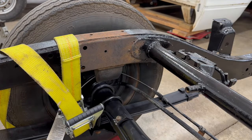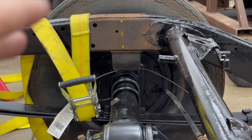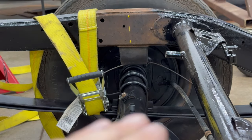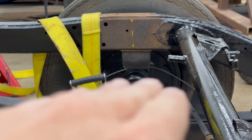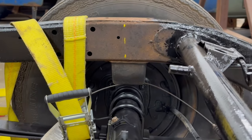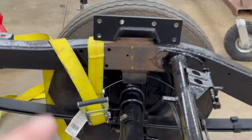With the suspension compressed, I can use a plumb bob to find the exact center point of the axle. There's my center line. One more thing to consider is if I'm adding blocks later on, which is going to reduce my clearance — look at the angle of the leaf. Imagine blocks on that leaf, which is already at a downward angle to the right. That's going to angle the axle up and to the right a little bit, which would end up putting me right where the stock bump stop is. That's going to put my mini notch right about there. It's always good to double check because every suspension setup is different.